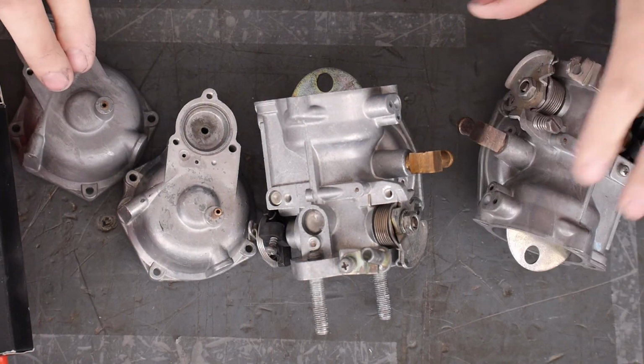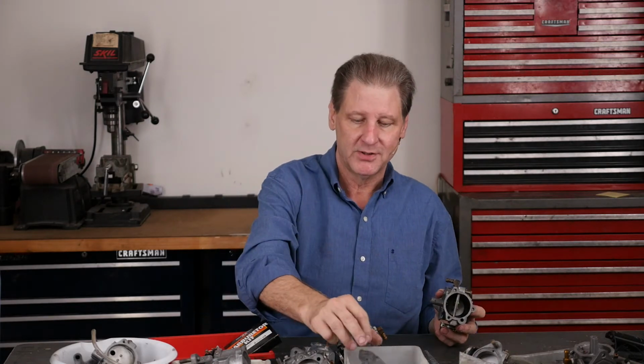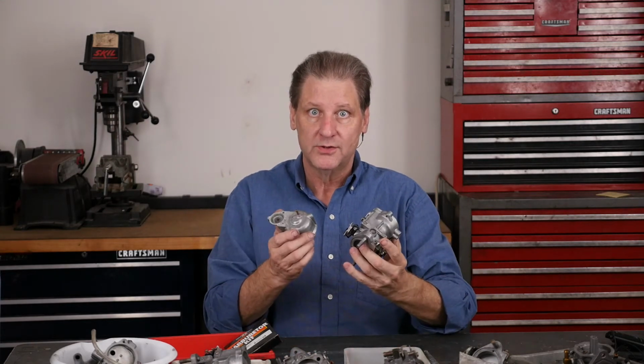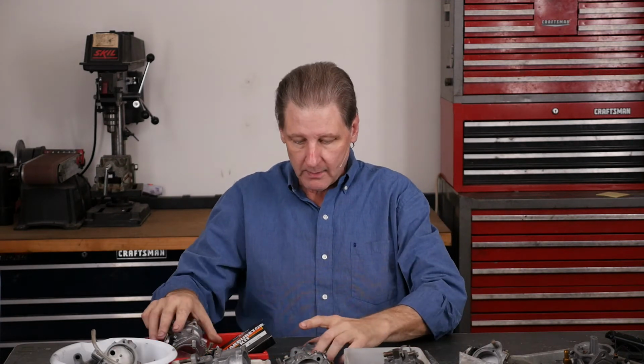The mistake here on these dark ones was using Branson MC1, which is not recommended for aluminum. Maybe I should have read the instructions before I bought it. That stuff's not cheap either. It's hazmat stuff. But MC3, which is what I used for this, fantastic. Bright, shiny, gorgeous.